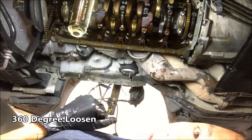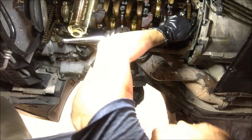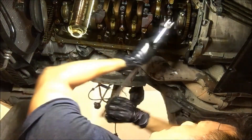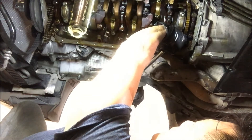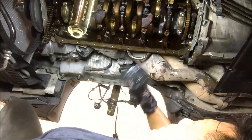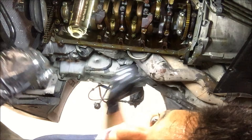So after the 105 degree torque, you've got to back it up 360 degrees just to loosen it up. I've got a breaker bar here. I'm just going to do 360 degrees — I don't think it has to be exact because it gets really loose. I wish I could fit the E12 on there. Let's just back it off — 183, 360 — that's a good guess. Alright, let's do the bottom one. Start from here, zero degrees, zero it out, then just rotate the torque wrench all the way back to the start position — up 360 degrees. Right now it should be really loose. I'll hand tighten it now and basically redo the torque procedure two more times. On the third go at 105 degrees angle torque, leave it as is.